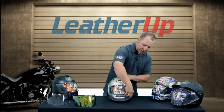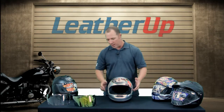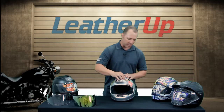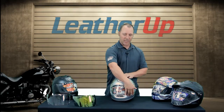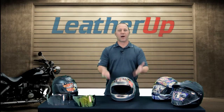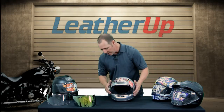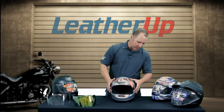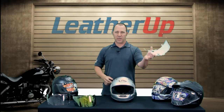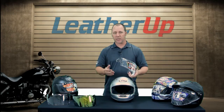Let's talk about the shield change on this helmet — it has a very easy shield change system. When you open the shield all the way up, two little arms pop out on the side. Those little arms are your release mechanism. With the shield closed it latches down; you come in from behind it and pop it up. Once it comes all the way up it releases those arms — if it's not all the way up they won't be visible. Take the shield all the way up, click the arms up, and then just lift the shield off the top of the helmet. Now you can get a thorough clean or swap the shield out.